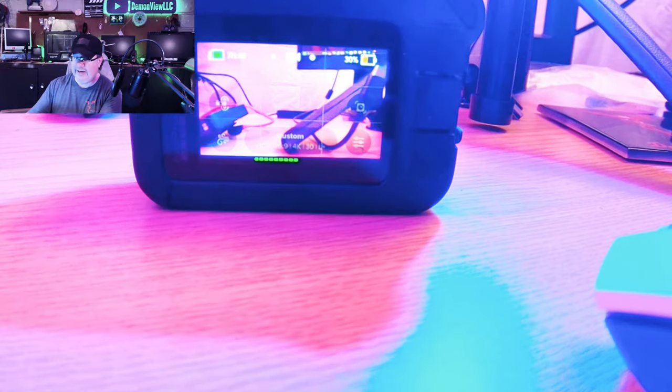The media mod offers much better value. It's got two cold shoe adapters — one on the side and one on top. It also has a micro HDMI port so you can enable 1080p video out, which is good if you want to capture video or watch on your television. Then it's got a USB-C port for powering your camera externally — I've done road trips with this camera with the max lens mod attached and had it plugged in, and it just worked. This is the Hero 12, by the way. And on the bottom, it also has a TRS 3.5mm line in, so you can hook up a mic, power, and get an HDMI video feed out. That is just much better value for money than using the GoPro mic adapter.